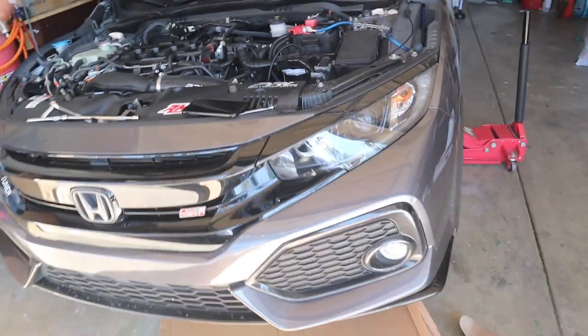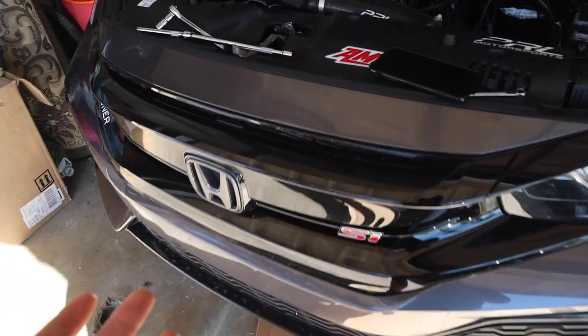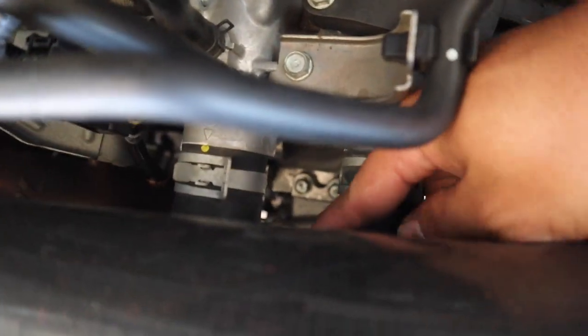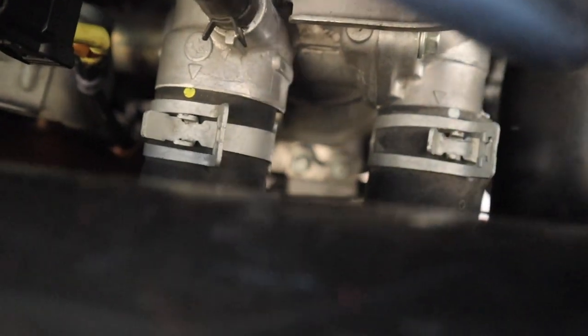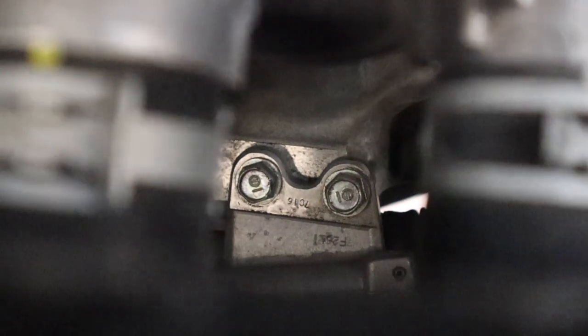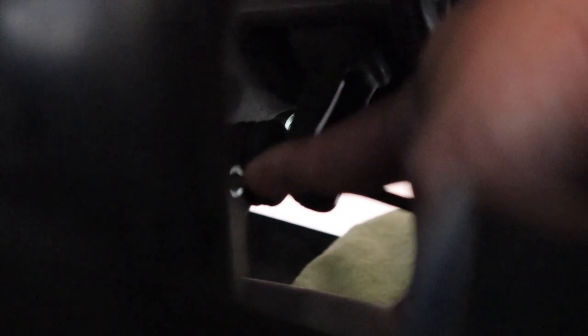First things first, it's optional to lift up the car — you don't have to. I just do it that way so I can clean up my mess right after, and I still have my skid plate to put back on anyway. Up top, you're going to see right here — that's your clutch slave cylinder. You're going to have two 12mm bolts right here. There's going to be two 12mm bolts right there, and you're going to get rid of those two bolts. Then you're going to have a hard line connected to it on the side right here, which is a 10mm to disconnect that.